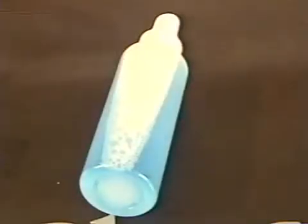When done curing with the UV light, lift up the pit sealer tab, scrape excess pit sealer off with a razor blade held at a 25-degree angle, and scrape firmly just in one direction. Wipe the area with a clean, dry, lint-free cloth and clean with window cleaner.